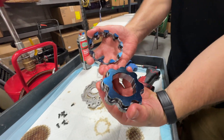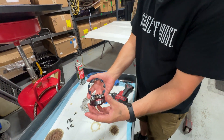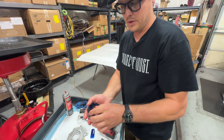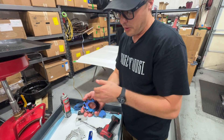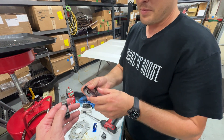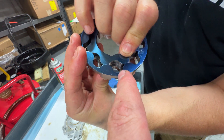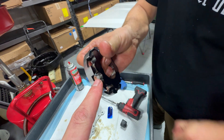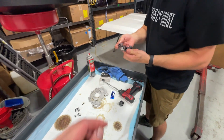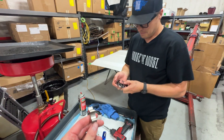Notice something different about these — they're two stages. Why does two stages help prevent cavitation? Well, you're not trying to do all of your pressurizing of the oil in essentially one stroke — you're doing it in two separate places. You're not putting all of that onus on just one side of the rotor. Every stroke of oil is just this one surface, but with two stages there are two independent strokes occurring — one feeding oil into the next stroke as it forces it over to the high-pressure side. It divides the work into two separate strokes, halving the stress on the tip of the gerotor as it turns.